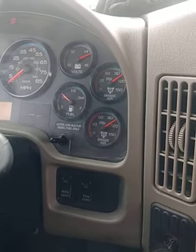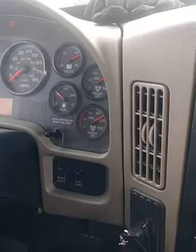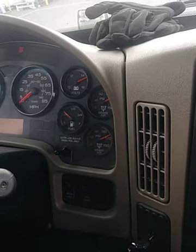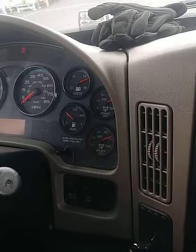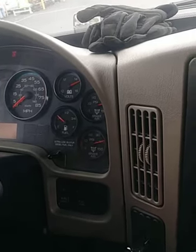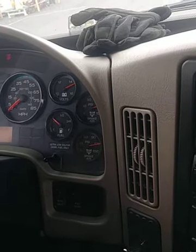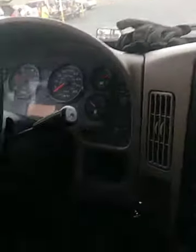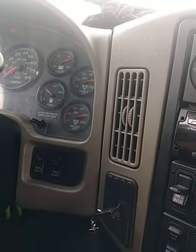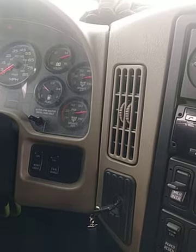For my next step I'm going to build to max pressure — you'll do your governor cutout again, cut in, and cutout — then tell them you're building to max pressure. For my next test is my applied leakage test. Purpose of this test is so that I won't lose more than 4 PSI in one minute in this combination vehicle — always say 'in this combination vehicle,' that's tractor and trailer.